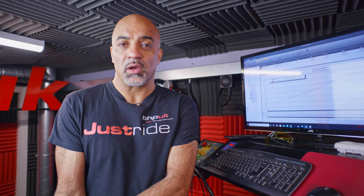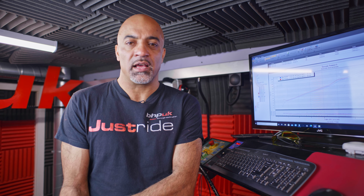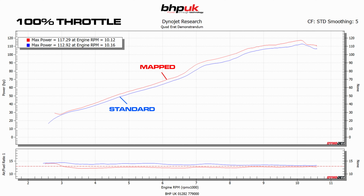So, what have we managed to achieve with the MT-09? Well, as we expected, we found the bike was lean. Most Euro 5 bikes are actually running fairly well at wide open throttle. With the MT-09, certainly with the decat and the end can, we found that it actually needed attention at the top end as well as at the bottom. At the top end, we've managed to achieve 117 brake horsepower, up from the standard 112 at the back wheel.